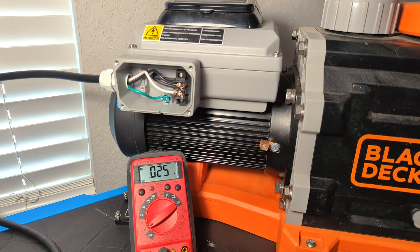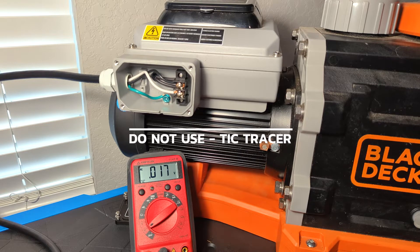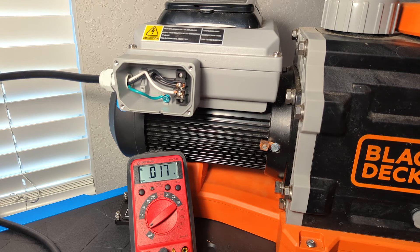But for checking voltage on an appliance like these, especially a 240-volt appliance, we do want to make sure that we're using something that can actually measure the voltage. What we do not want to use are the little tick tracers, the little non-contact ones with a little white nub on the end. Those really only show the presence of voltage.